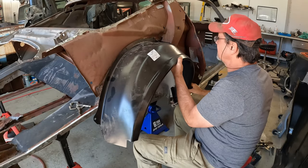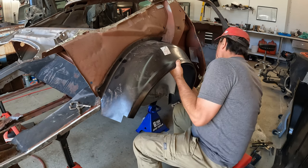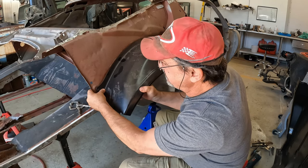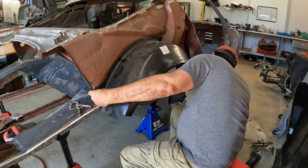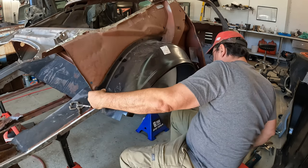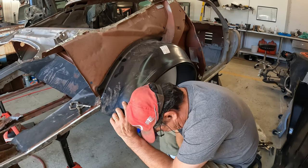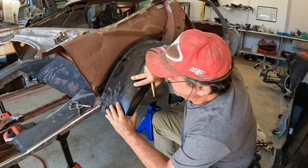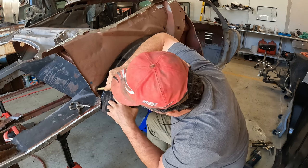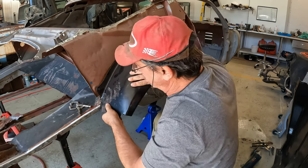Okay, slide it up under, kind of rotate it down. Pretty close there. Go back underneath here. That's not bad. I'm just about on the money over here. And here, I could do one of two things. If I can find it. There it is. You can take a punch, come in to your alignment mark. Sometimes that works, and it'll work in this case. But this thing is pretty close. I can maybe just muscle it in.